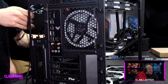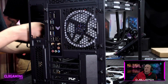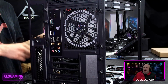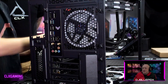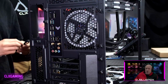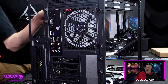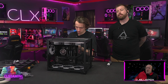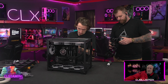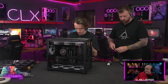Nice. Alrighty, taking a look at that back panel, you can see all the ports that are available for the connectivity of this board. While you're doing that, I'm going to talk about those options. On the very top, to the right is the HDMI port, and to the left is a DisplayPort, but we won't be using those because we've got the graphics card. Below that are two USB 3.2 Gen 2 ports. Then below that are two USB 2.0s, and below that is one USB 3.2 Gen 2x2 Type-C. That's a lot of words, and what that means is this port is a 20 gig port, 10 up, 10 down, and it can transfer a lot of data very quickly. Next to it is another 3.2 Gen 1. Then we've got two USB 2.0s and the 2.5 gig Ethernet port, which is wild because that's a lot of connectivity. The Wi-Fi 6 antenna mounts are just below that. And then, of course, you've got your BIOS flashback and your 7.1 channel audio options. So there we go.